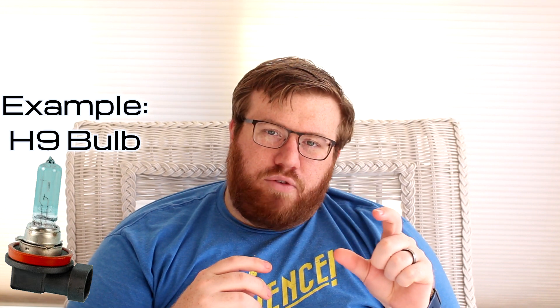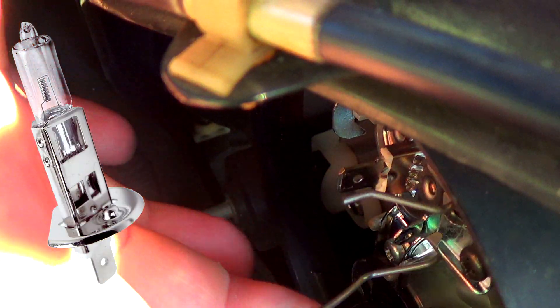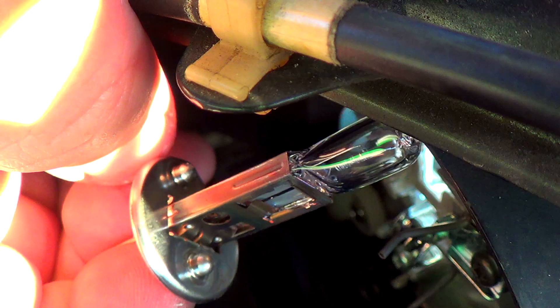There's a detail from my previous video that's relevant here. Some headlight housing designs have a cap in the back — you put the light inside the housing and seal it with the cap. With that design, the cap seal is your main line of defense against dirt, salt, and water. This design sometimes uses bulbs other than the common 9000-series like 9006 or 9007 — those are glass on one end with metal and plastic on the bottom. There are also bulbs like the H1 where most of it is metal, and I don't know of anyone putting this stuff on the contacts of those mostly metal bulbs.